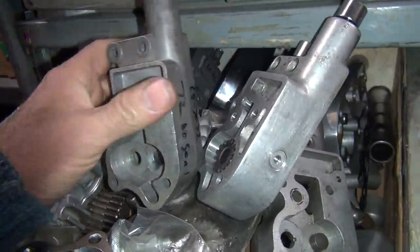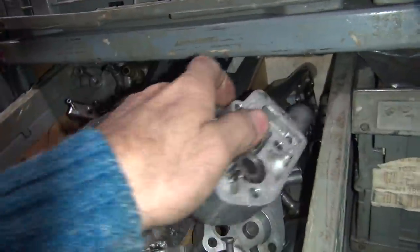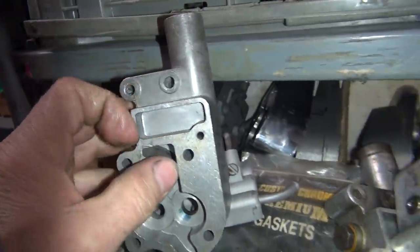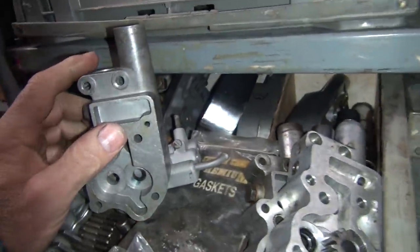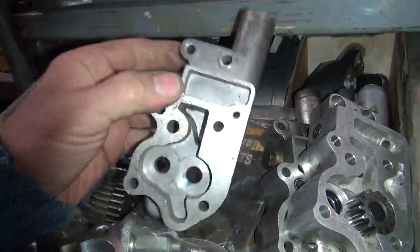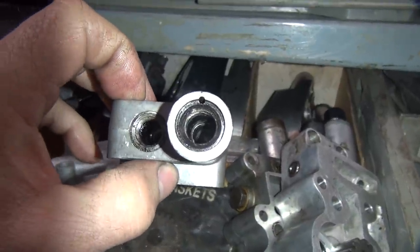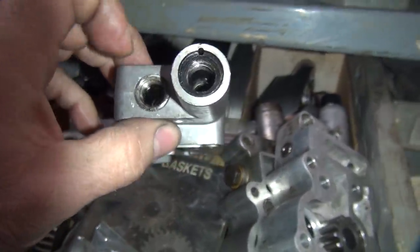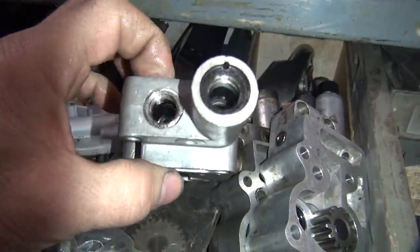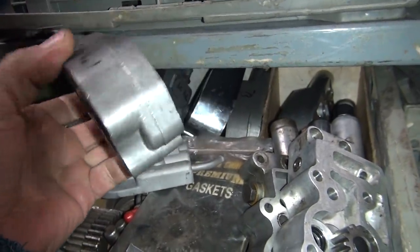Because you have about three quarts of oil in your oil tank on an FXR. Three quarts of oil will eventually leak down through all these holes. For that one month it fills up in your motor - you've got three quarts of oil on your lower end, so the lower end is well lubricated when you go to start it, and it comes right out the breather. The way you fix this problem is you take a ball bearing, weld a piece of rod to it, put lapping compound on it, and rotate with your fingers until you see a nice good seat. The problem is you don't want to put lapping compound on motors at all, because it goes in your motor and destroys it.